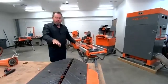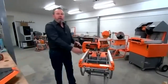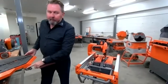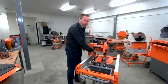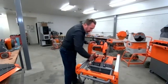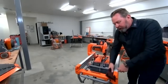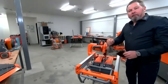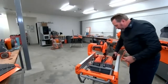While we're tuning up the table, sometimes people will say the table feels kind of chunky as it's traveling through. If you look at the side of the table, the upper rollers are pushing down on the rails. Sometimes they pick up some chunks or debris on the top side. We recommend taking a little scotch bright and cleaning that top surface. You don't need to use any oil — just scotch bright. Run your finger across to check for chunks. If you use oil, you're going to catch more debris and it will get even more chunky.